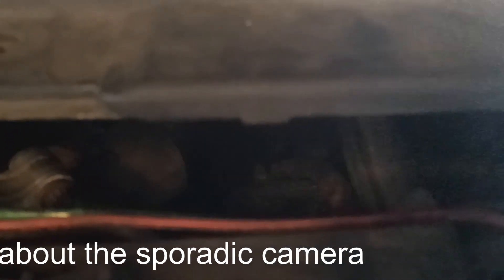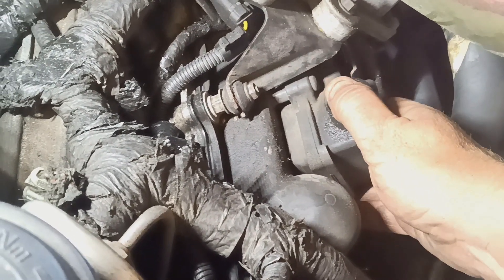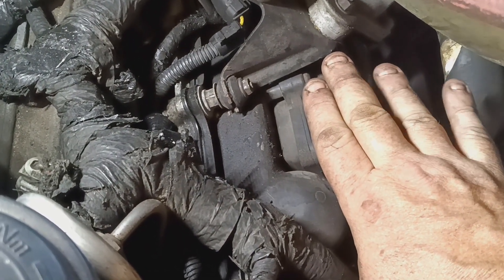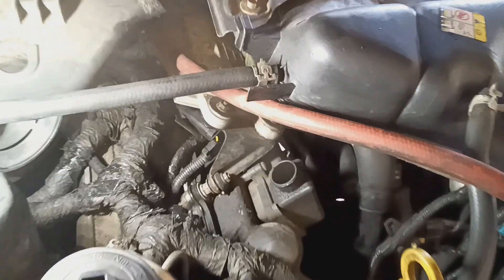Now I just have to figure out which side the leak is on. By covering that hole you can hear that that's where the pressure is — it's right here on the driver's side. So we'll start off with the driver's side valve cover and continue on.